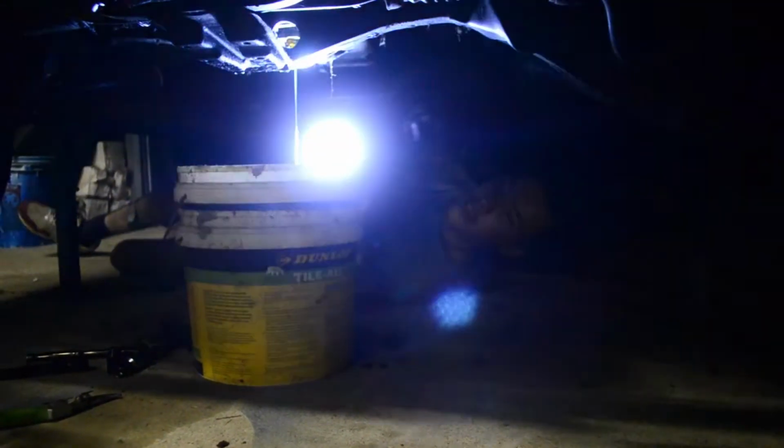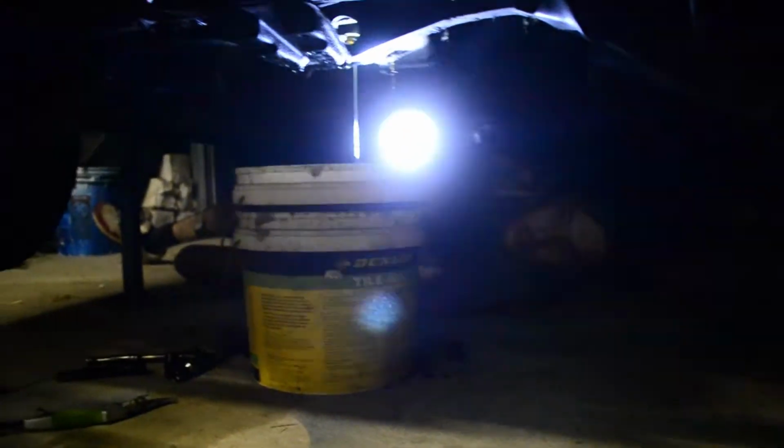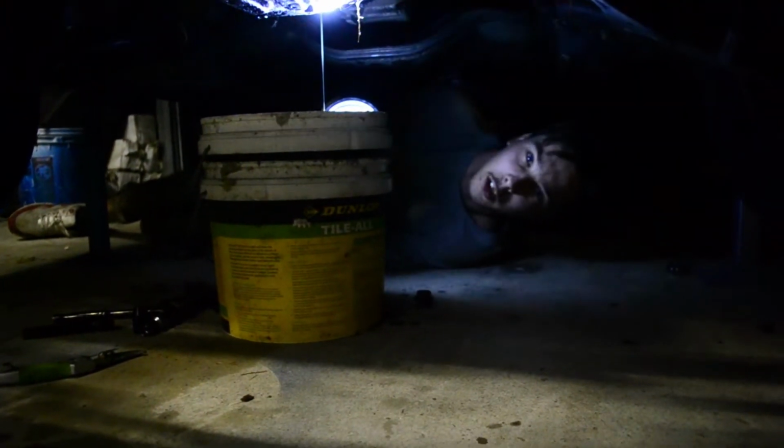Alright, so we're draining the oil right here into this bucket. And then that's the gearbox that we're draining. And then we can pull the drive shaft out and catch whatever falls out of the back of the gearbox when we pull the drive shaft out. And then we'll be taking the transmission cross member, the gearbox cross member, undoing 2 bottom engine mounts and pulling this thing out.